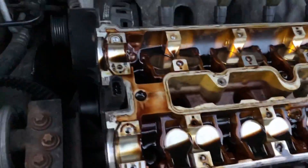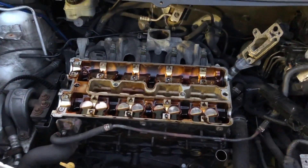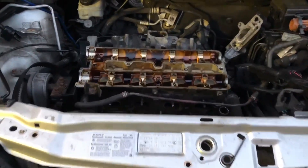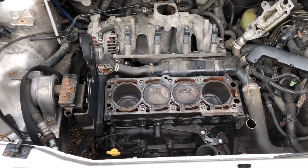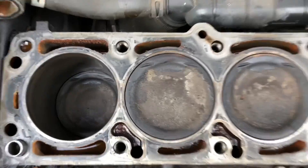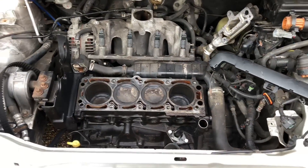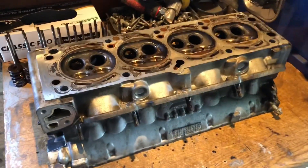Just got to crack off the head bolts, couple of bolts in the cam cover and the head can come off, and then we can get inspecting. It's only taking about an hour - it normally takes me less time to get the engine out, but this time I thought just pull the head off and do it in situ. So that's the head off. It's one of the only Zedlets I've come across that doesn't have copious amounts of dent marks all over the pistons. It's been a pretty standard car in its life, so it's in good condition.